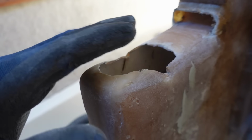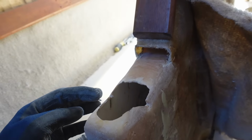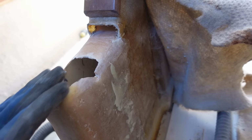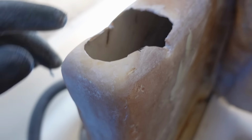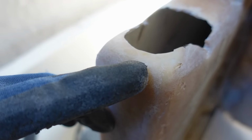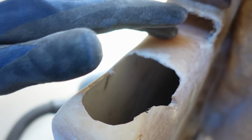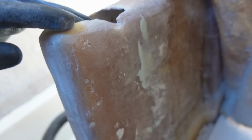So on the bottom of the compression post, I'm getting a piece of stainless welded in now. That's why it's not here. And once that plate's on, it'll spread the load across this whole top bit. So you can see how it's gone slightly yellow here, almost turning back to white. Also around these edges, that's basically because it's almost at the gel coat, as well as there, because I've tapered it up the back here, tapered it around the edge here, tapered my best around this side.